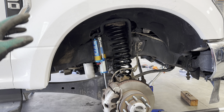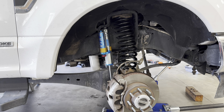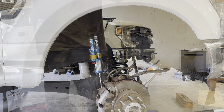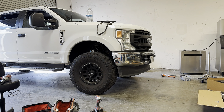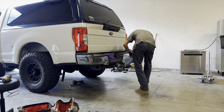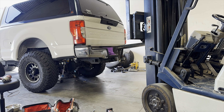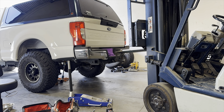Now I'm going to jack up the front axle, throw the tires on, spin the truck around, and then do the rear shocks, which are just direct swaps — stock ones out, King in. Removing the spare tire is not mandatory; I just did it because it's useless to me — I already have a full-size spare in the bed. Again, with the compression, I used the jack with full droop of the axle to get the shock in because they are very hard to compress.